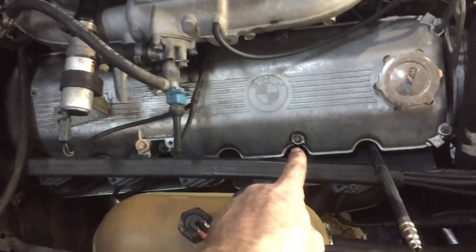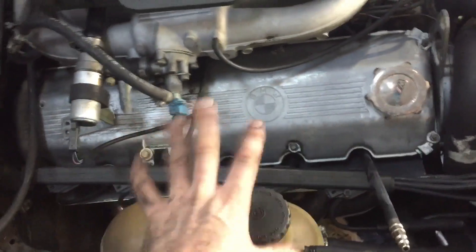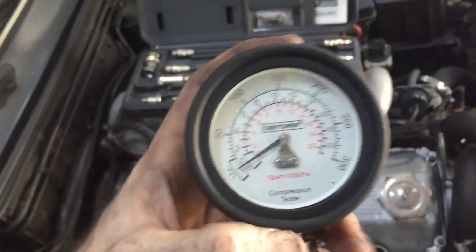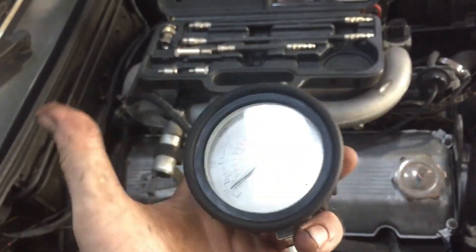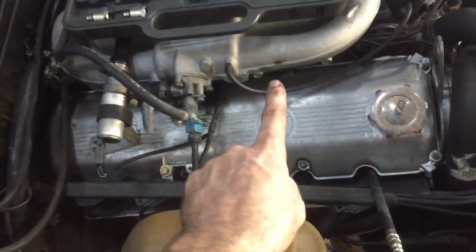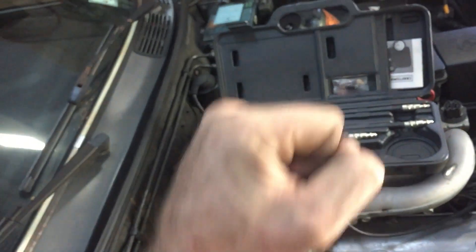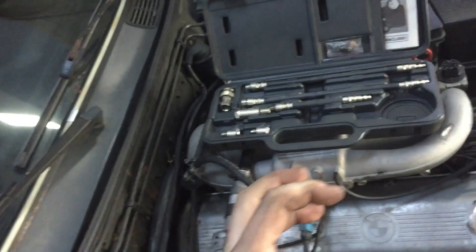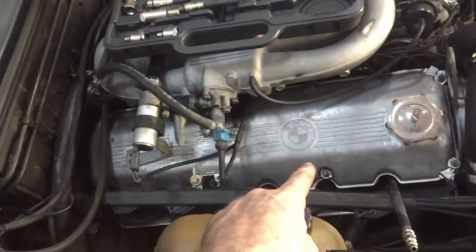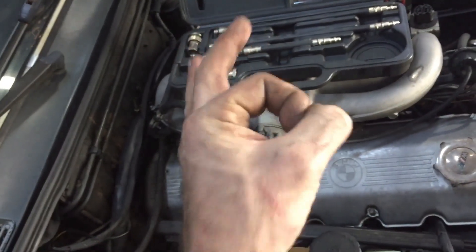So we have a couple of problems right here. Let's say one of these is only 80 — we're under spec. Oh my God, what happened? We're not even over 100. What that means is this cylinder cannot hold pressure when the piston's coming up. It doesn't have any pressure. It's not holding the gas and air to ignite. You're going to get a misfire. The car is going to run erratic. And something is wrong here — either the piston has a crack in it or the valve is stuck open.